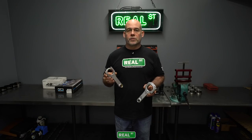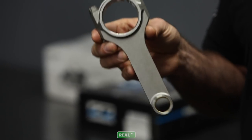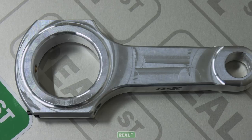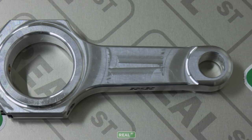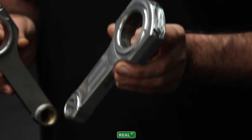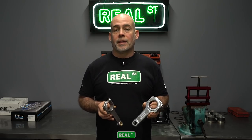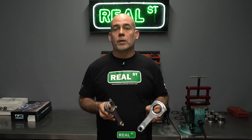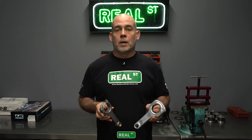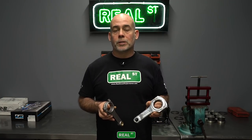Keeping the same train of thought as far as the temperature dynamics: your steel rod at room temperature, you'll measure your housing bore ends and your pin bore end and you'll use what the manufacturer suggests. With the aluminum rod, if you have a room that's say 75 or 80 degrees Fahrenheit, you'll have a housing end that's a little bit smaller than what the book calls for. So what I'll do is I'll have a pin target clearance of say 9 tenths, just under a thousandth, and a big end housing clearance that will be undersized. However, if you warm the rod up to say 100 degrees, you'll see that this changes a lot. So in an effort to set bearing clearance and be comfortable with what you're doing, know the temperature that you're measuring the rod at.